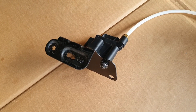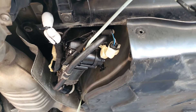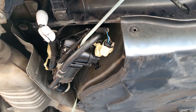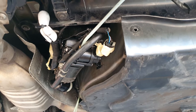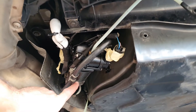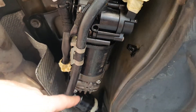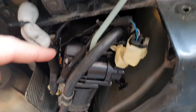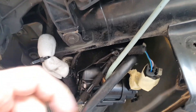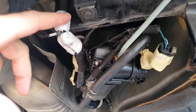I'm fairly convinced the problem is in this valve, so I'm considering replacing it. For the compressor, keep in mind I have already opened it — there is a piston inside. In my model it is not possible to replace just the piston ring, but you can find online for a reasonable price the external cylinder — this gray metal part — which comes complete with the black cartridge containing the silica gel, and also the release valve. Also take care of the electrical cables, as the compressor vibrates and the cables can get damaged from touching the metal frame.